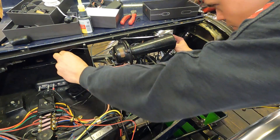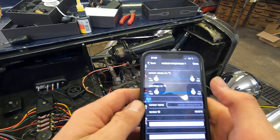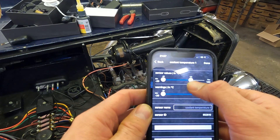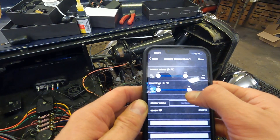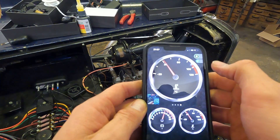Now I can hide the wire somewhere on top of here. Here you can see the temperature sensor. I think the maximum is 120, and everything above 120 is not good. My warning I'll set to maybe 100 degrees or maybe 95. Done.